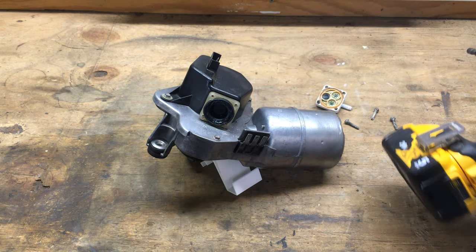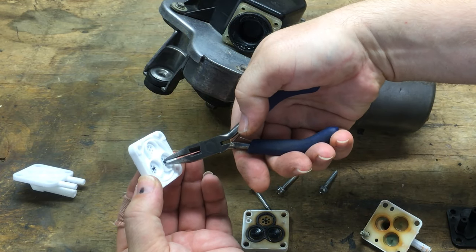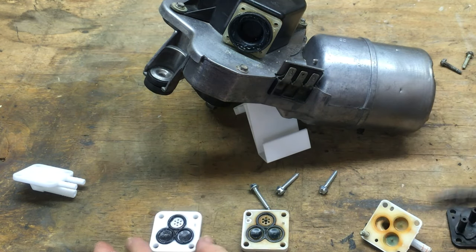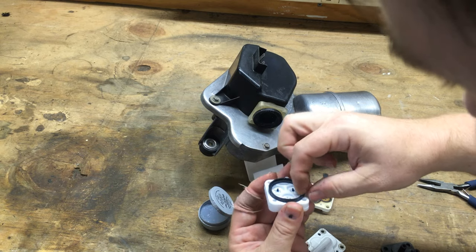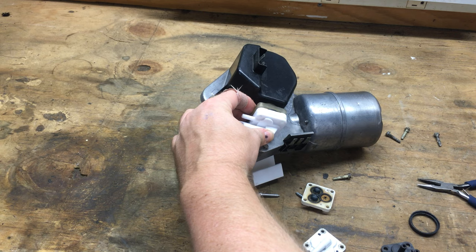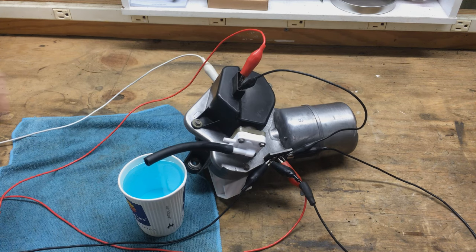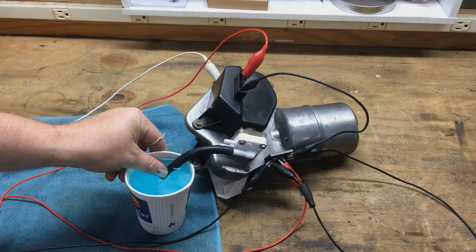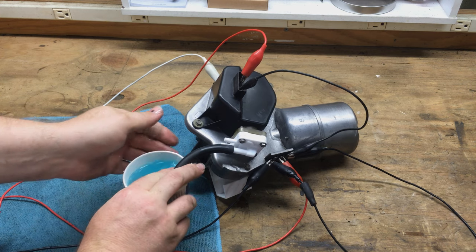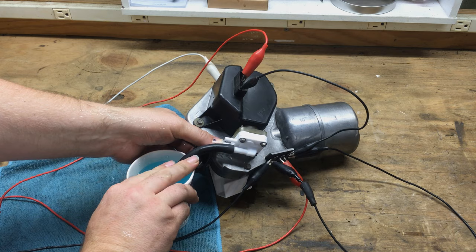Disassembly is not that hard — you've got the four screws, and this kit did come with everything that I needed. It's got all of the rubber pieces in it, including these valves that you simply push through and then pull with some pliers to get this little nub correctly seated. Make sure you put a third valve on there on the opposite side and don't forget it like I did and have to do it again. The kit came with a rubber gasket, but I found it didn't have an application for this unit — the input and output block just simply attaches to the other side of those bellows. Everything is tightened down, and then we put it down in some washer fluid and see if it'll pump again. The test is working; you can see I've got a little less output out of the top, but I put my thumb over it and you can see it's got a good strong stream.